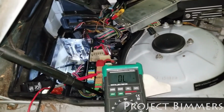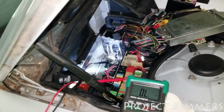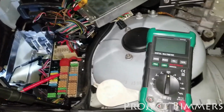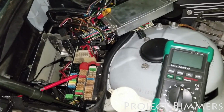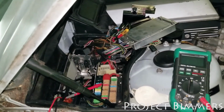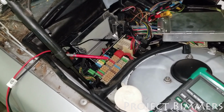So troubleshooting would mean I would have to go all over those places with my wiring diagram, see if the connections are there. If the 2 wires that I suspect to be connected do not beep when I'm doing a continuity test, that means that there's a break somewhere along the wire. Now, a break can be the wire is broken, or the wire has a short, or something is not connected, or the fuse is blown or something, and that would help me to determine where the problem is. So that's a troubleshooting technique that I use, checking for continuity.